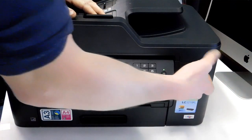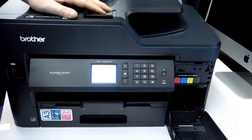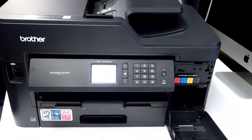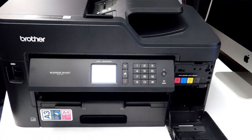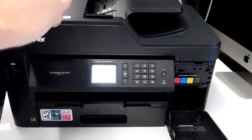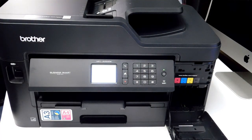At the moment the printer is powered on and I've got no ink cartridges in the printer. On the instruction sheet provided you'll be given a video link for filling and priming. Prior to installing the system you must fill it and prime it before it goes into the printer. Please don't put the ink in the system and then run head cleans or raise it in the air to get the ink to travel down the lines — you must fill it and prime it prior to installing.